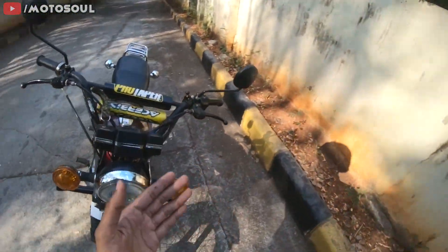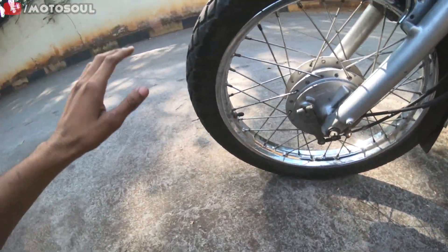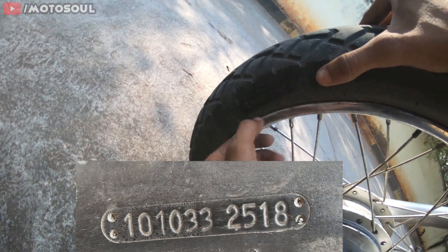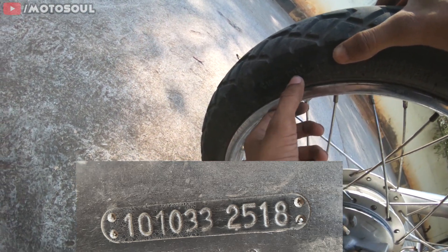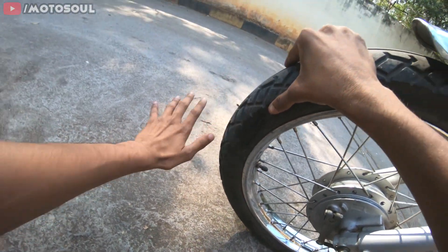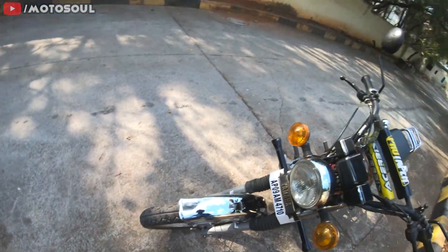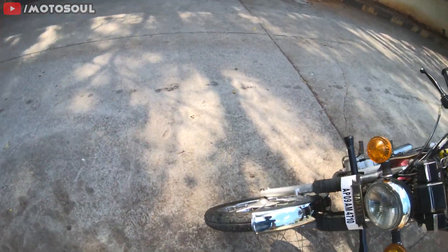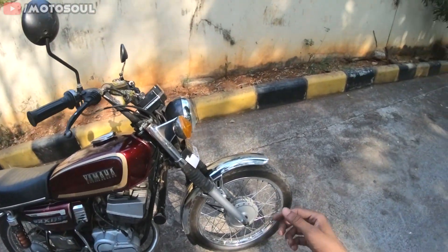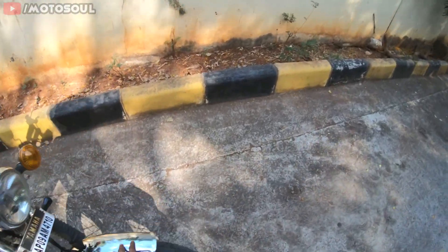The other way to check is the year of manufacturing. If you look right here, this tire was manufactured in 2018 — the last two digits are the year and the first digits are the week. The shelf life for a tire is about three years, and this tire is now more than three years old. I originally had it on my blue RX but swapped it out and added new Ralco tires to the RX 100.